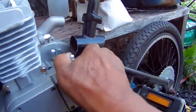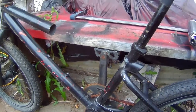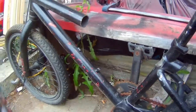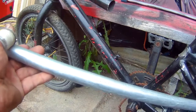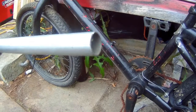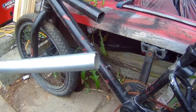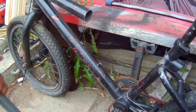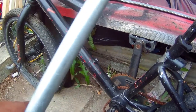What I'm gonna be using to bring this around is conduit pipe — I'm sure you've heard of it. It's pipe they sell for industrial places to run electrical wire. This stuff is galvanized, and galvanized is very toxic to weld, so if you ever use this stuff, make sure you wear a mask.